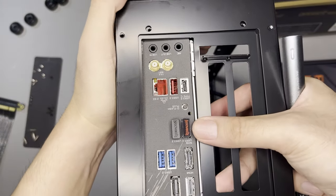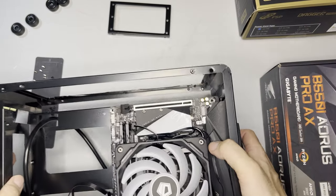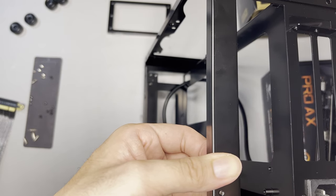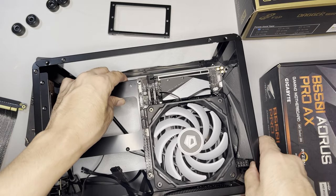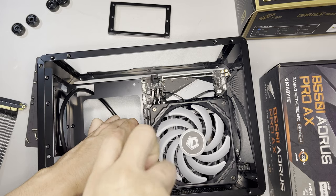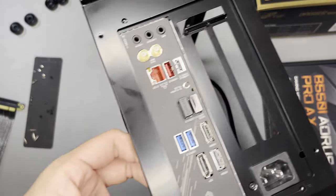The problem with this cooler is, of course, the height — it's tall. I cannot install it the other way around as it will hit the heatsink. Since this case has a mount for the 120mm fan at the bottom, it will go in just right. As for the motherboard screws, they're using a non-standard screw — usually it should have a crown, but this time it doesn't. I'm having trouble because of the instability of the case. Temporarily, I put in two screws to make it more stable so I can install this properly with all the screw holes aligned. That's the toughest part.